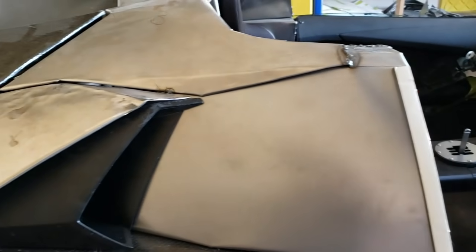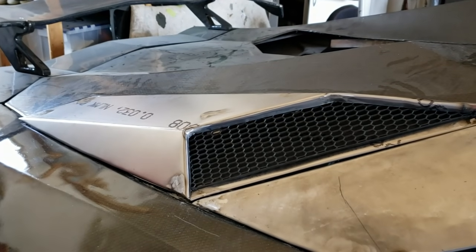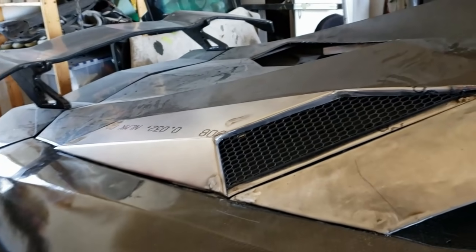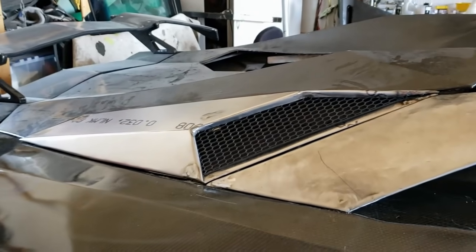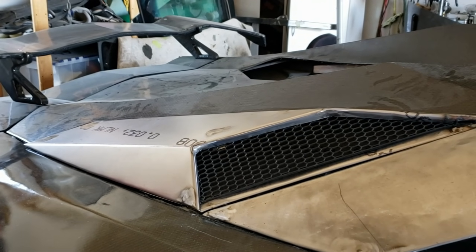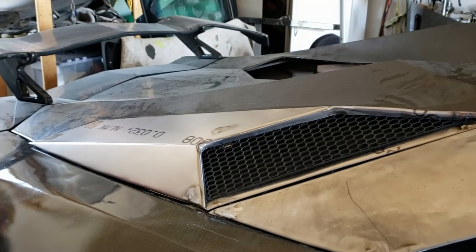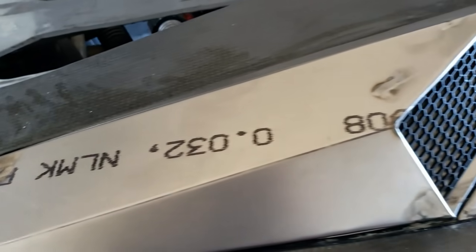The other major thing I did yesterday was I redid this section. I tightened it up. I did a bunch of metal work on the sail panel here and I broke down and made the scoop out of steel. Let me explain why I did that. I know this is 3D car printing, but when I was going to get done with the scoops they were going to be heavier than this 32 thou steel, and I don't think I would have been able to do the carbon fiber without too much distortion. It actually only took me about an hour to fab this up.